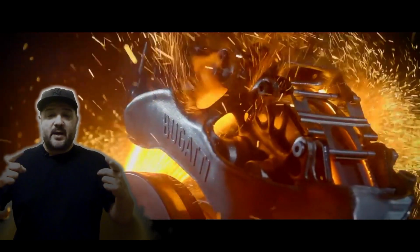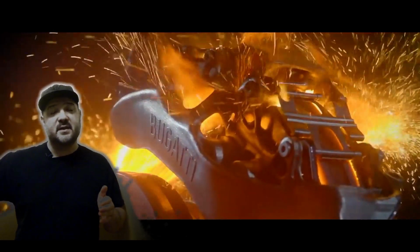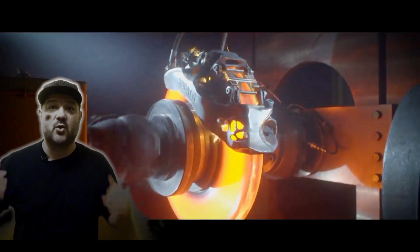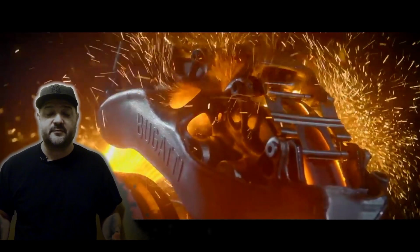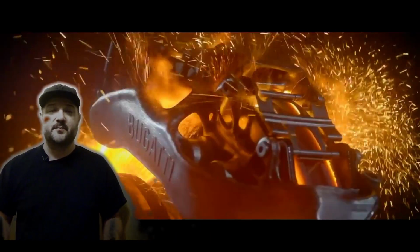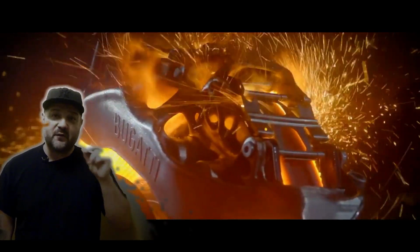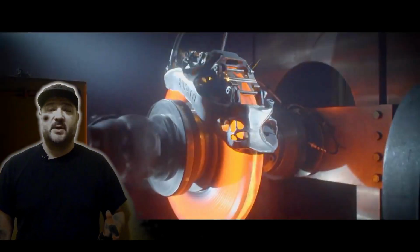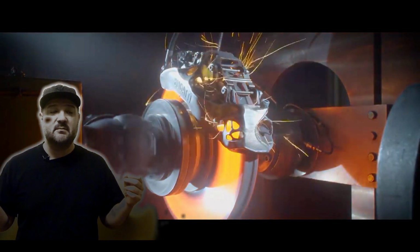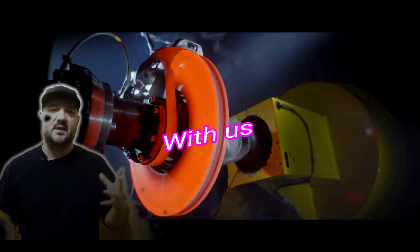But what people don't talk about is what you need to add or buy on top of the brakes if you're going with a factory Scat Pack Hellcat type of brake: brake rotors, pads, the calipers, all that kind of good stuff. Number one thing, you need 20-inch wheels. Number two is that you're going to need the proper backspacing of those rims. That's another added expense. So you're going to spend probably in the range of I'd say $1,800 to $2,400 for a factory setup.